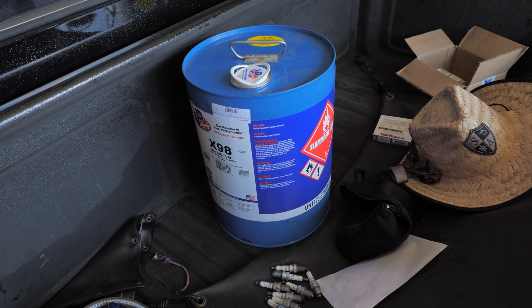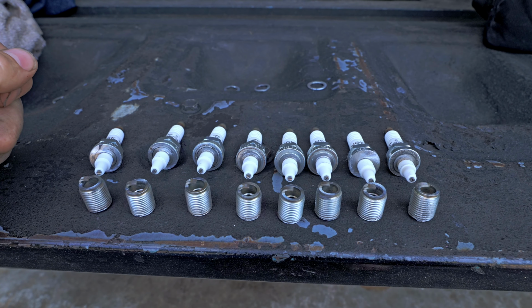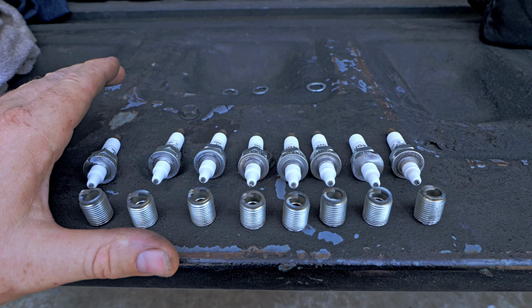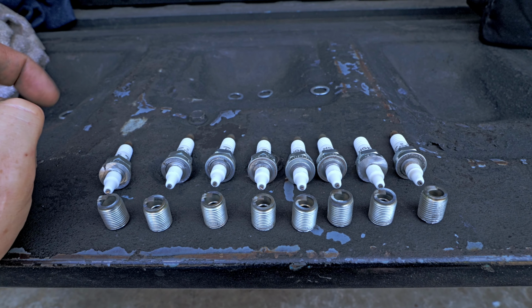I'm going to put that X98 because man, it is just way better than that pump stuff and adding gas to it. So the plate that I want to get is going to be this one. And I know a lot of people are talking about, hey, get an Induction Solutions, they're the best. And like I said, I'm going supercharger next year. So I don't see myself spending $1,200 on just a plate. I know they're awesome and they're great and they give you great tune-ups because they flow them, but I'm just going to get this crossbar plate. As you see, that is way better than my current distribution. It's got to be. Look at all them holes. It's ridiculous when you look at those two side by side, the difference in fueling. So just for now and for safety, we'll make some more hits later on. That's the plate I'm going to get.